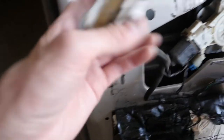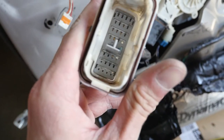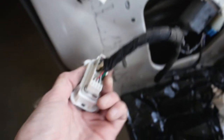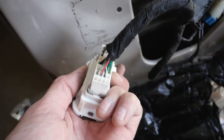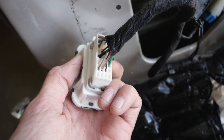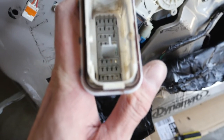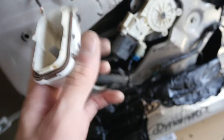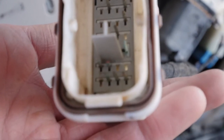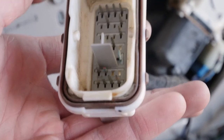Now I've got this over here — this is the door side connector, the waterproof switch thing. The three that looked really corroded were these bottom ones. Gray, red, white, black, white — those are the power window wires. My thoughts are that corrosion on those three terminals is the whole problem. The issue is at this door jamb — that little red bit that was sticking out on the other side. Yeah, that's definitely broken off.